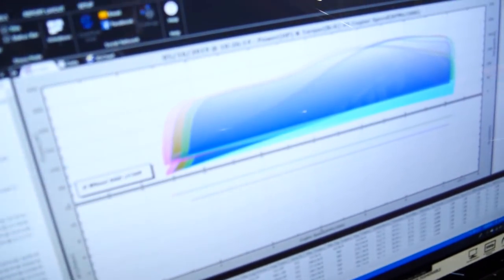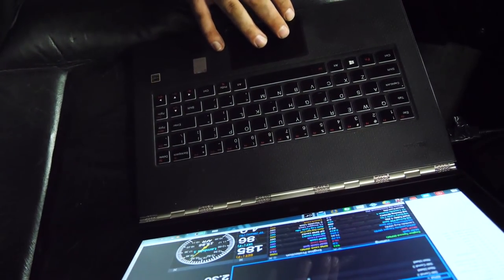Let's get to the fun stuff of increasing horsepower. Although, probably by the end of this we're just going to be at the same number we were at last time. Naturally aspirated cars aren't as fun because you can't just push a button and make a bunch of power. Intake butterfly valves are now plugged in. Take a good look at the torque curve right now. I'm going to mess with the RPM limit of the butterflies to make sure that they're working the way we want them to, and then start running it on the dyno and see where we need to actually have it set.